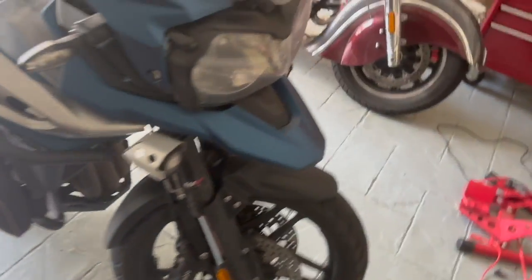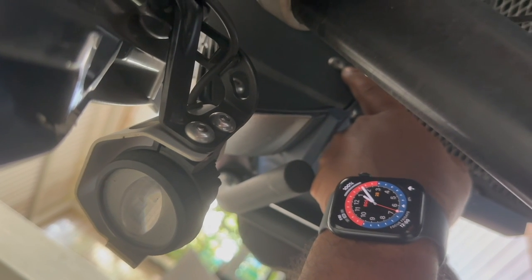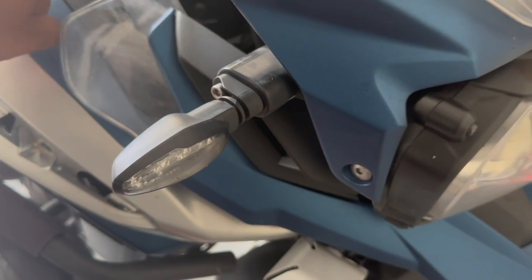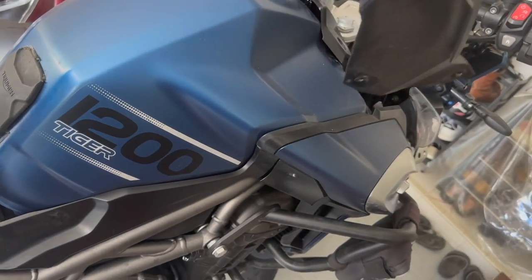The panel is still not loose. Turn the handlebar — on the inside there are three 5mm screws: one on the top and two at the bottom. One is behind the fog light, and they can only be reached with an Allen key. Let me remove those three bolts and the side panel should detach from the tank. I've removed those three screws with an Allen key on the inside, and that lets you take out this panel — just pull it out.